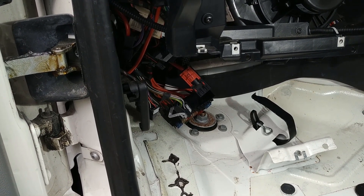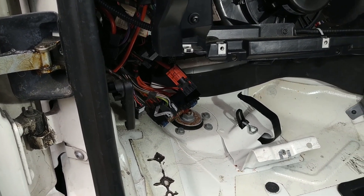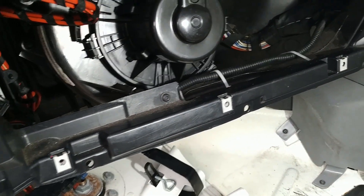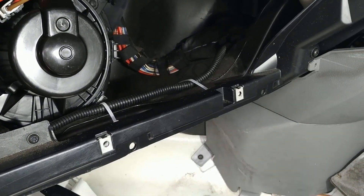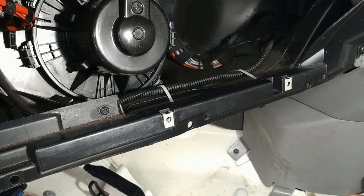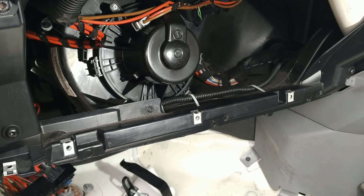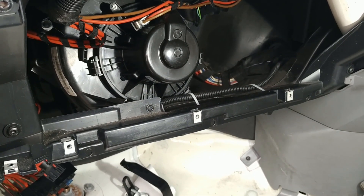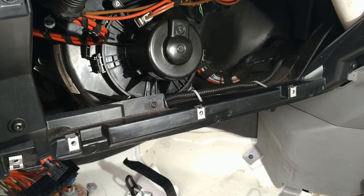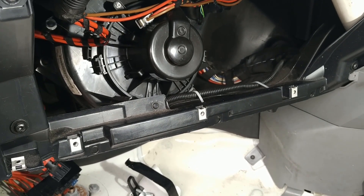The other thing I need to find in this van is an ignition-on feed. There are loads of those — quite a few presented under the passenger seat. In this case I'm actually quite lucky. There's a cable there, cable-tied in — it's the only one I left when I ripped out all the original electrics. That is the ignition-on feed that goes to the blower control switch for the rear air conditioning unit. I'll spur off that to another relay to provide power switching for anything I want to power up when the ignition's on, albeit without the engine running.